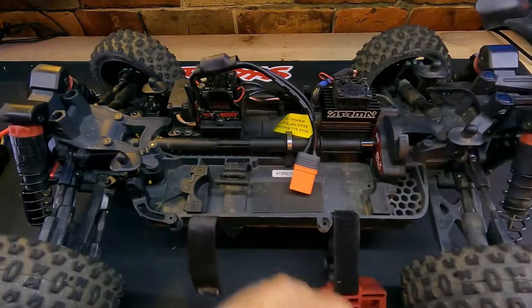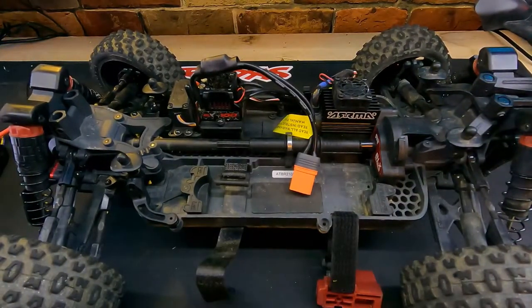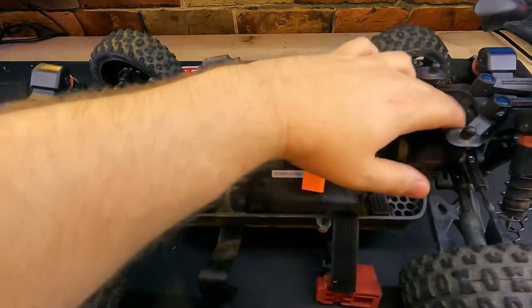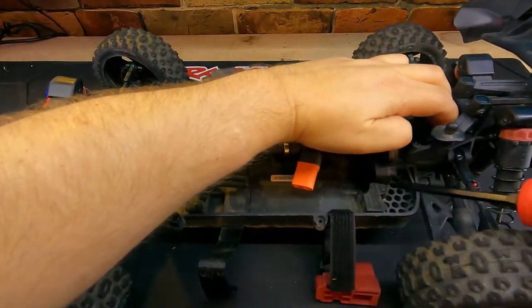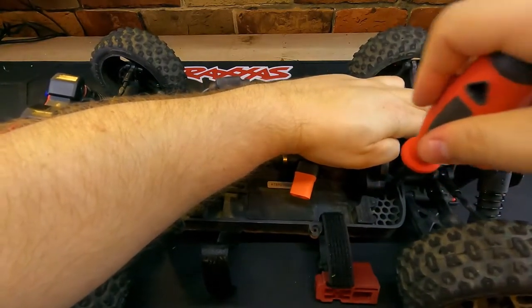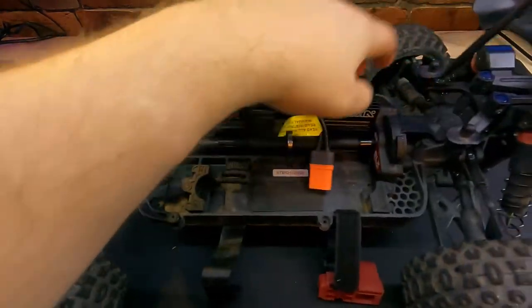Once that's out of the way, you can lay this back. You will also need to slide the whole motor assembly out toward the front of the vehicle, and this will also be another useful application for the flathead screwdriver. The goal here is to lift the two tabs and slide the motor assembly forward. But if you get a little dirt under the motor mount assembly, that will cause some binding and make it tough for you. So slip this forward here, get the flathead screwdriver and let that screwdriver kind of be a prying force to slip that out.